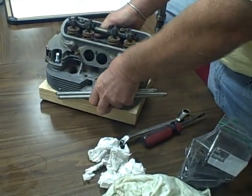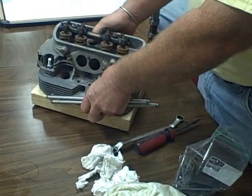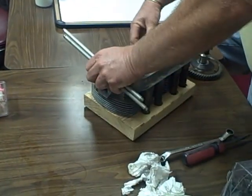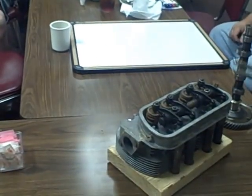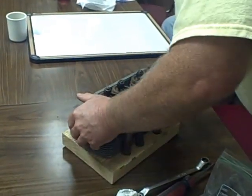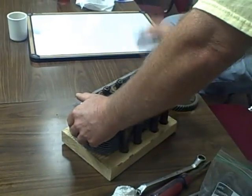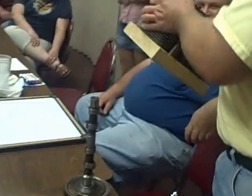It's called a KD bushing. This one's got a KD — you can do the head on the car. It's a two-stage tap, with the original thread on the bottom. It has a reamer and it taps it out bigger. You take this KD bushing, which you can buy at Sears or anywhere, and it's screwed in like a spark plug. This one's got a bushing in it on this side, but this one right here is beyond a bushing — that one's beyond repair. I think this would almost take a full inch hole. A little JB Weld? Yeah, I don't think that would be fair enough. JB Weld. Thank you.